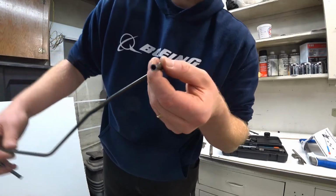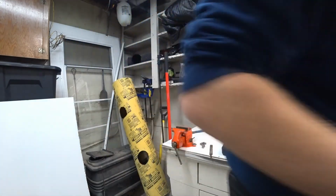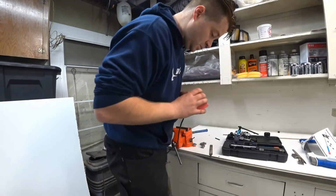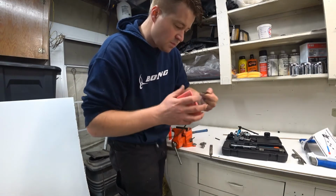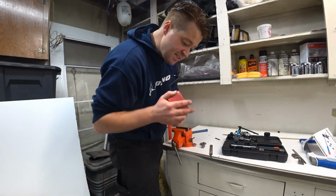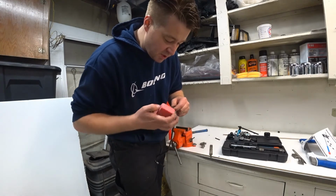Now this is what the tube looks like. It's got some burrs, so I'll take a little fine sandpaper to take those off, and they're not much. Maybe I should use a little diamond thing here. That'll do it. Yeah, this paper's a little too fine. Oh yeah, that works well. I'll have to clean this tube out really well so we're not introducing little diamond bits into the engine, right? The point here is not to actually put a chamfer on this edge, but just to deburr.